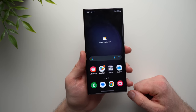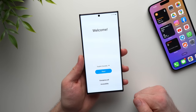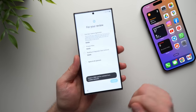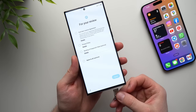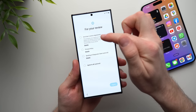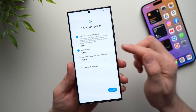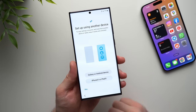Now let's do the same thing on the iPhone. We've done another factory reset and we're back to the initial setup wizard on the Samsung phone. For this part of the video, we're going to transfer everything from our iPhone to our new Samsung device. We're going to hit Start, and it's asking you to insert your SIM card. So take your SIM card out of your iPhone and plug it into your Samsung device. Now we can continue, agree to the license agreement and privacy policy — we don't have to agree to sending diagnostics data, that part is optional. Tap those two and then hit Agree. Down here, we can select our iPhone.